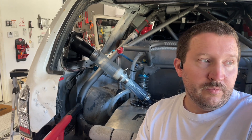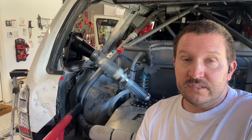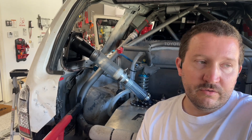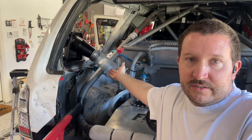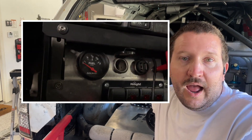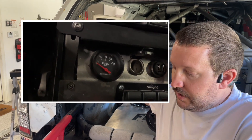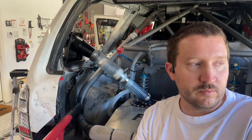The cowling that we are mounting the advertisements on — the quarter panel cover — we are making that out of a new material rather than all steel, so you can see through it. The people filling the car up for racing can actually see the necks, the actual tubes, so they know when to stop. I find a sending unit to be useful, but the other race car guys with more experience don't trust sending units all that well, so they prefer the pit crew to be able to see what's going on inside the filler neck.